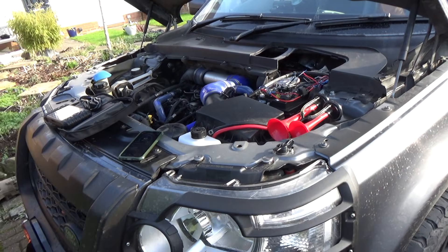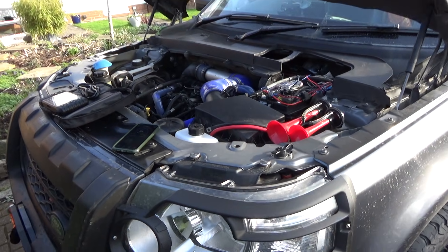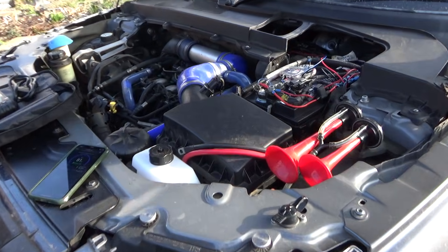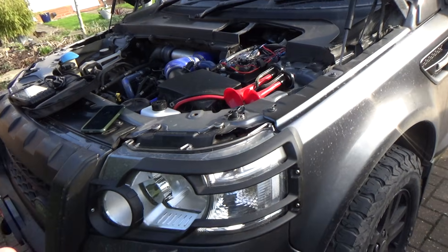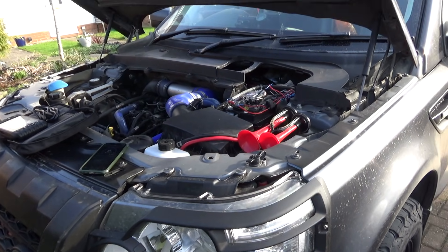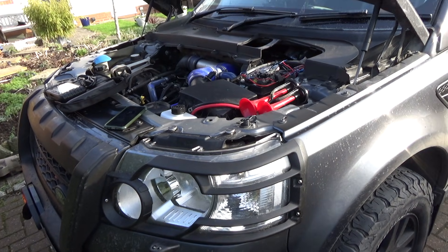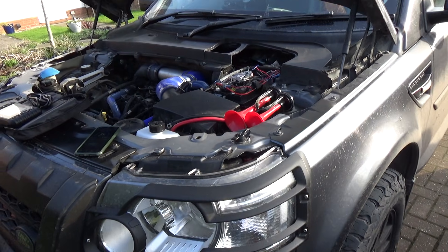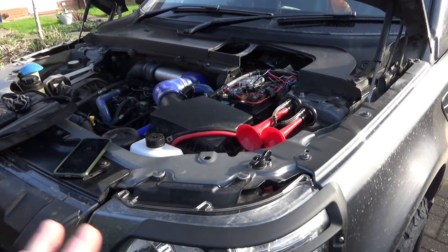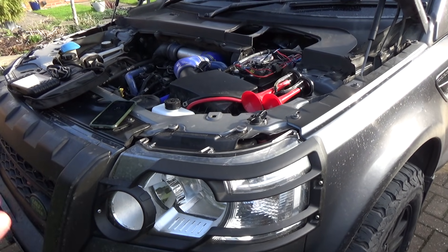I've also noticed the Eco stop-start. My car has this stop-start feature and it started to work again. It tends to only really kick in in the summer when you're not drawing a lot of current from the battery. In winter you've got heated seats, heated screen, lights and everything else on, and the computer decides whether to do a stop-start cycle. If there's a lot of demand on current, it won't stop the engine in case it can't start again. This morning, even though it was freezing cold, after about five miles the battery charge had increased to a level where stop-start started working again.